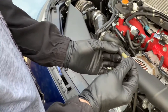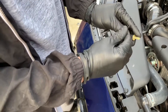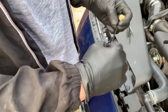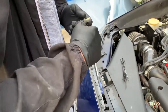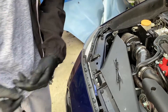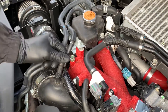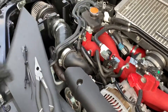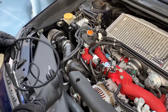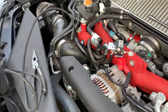After you got those two pieces, you want to put those two together. I don't like how loose this is, so I'm gonna zip tie it. I like to put zip ties in all my stuff — I don't like it when anything is loose, especially to do with boost. Because then your car can run really lean if one of these hoses blows off — that is not good. Put the hose right on here. It's gonna be a tight fit. We're gonna put a hose on here, make sure it's on there nice and tight, and get a zip tie on there.